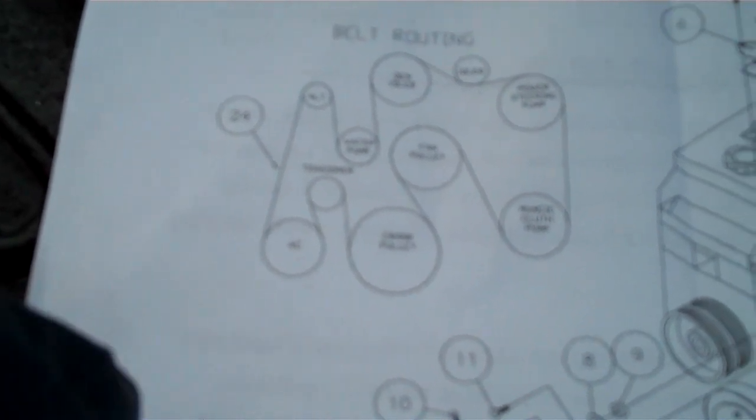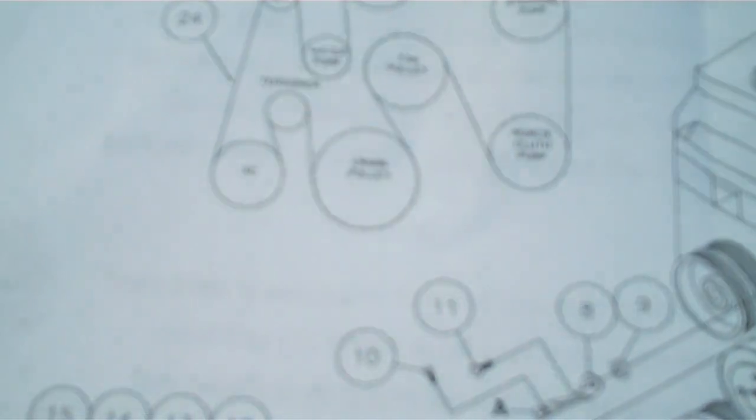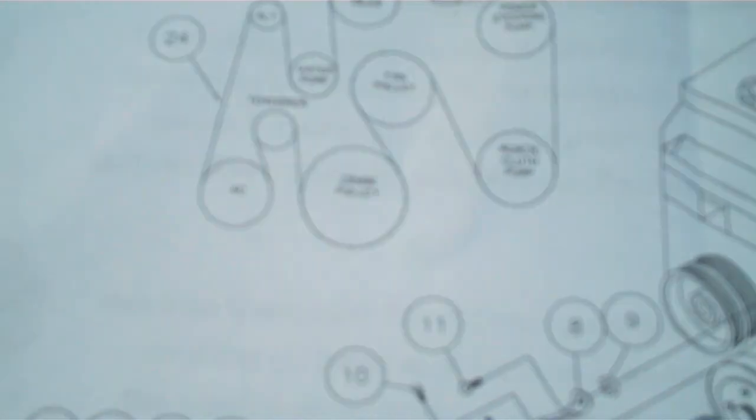The first thing you want to do is load the belt around the crank. To do that, you do it from underneath and wrap it down below the crank. Then the fan pulley and the crank pulley are very close together and on top of one another. You have to have the belt going horizontally across between the two. Being that it's an eight-groove belt it's going to be difficult, but just slide it in and rotate the fan counterclockwise or clockwise depending on which direction you're trying to pinch it through there. You'll find you'll be able to get it in no problem.